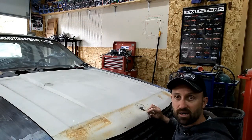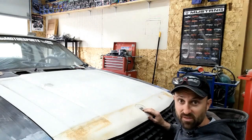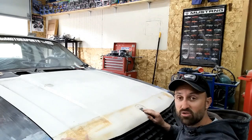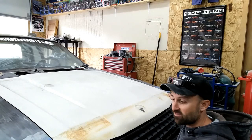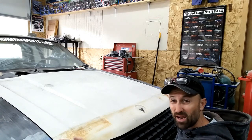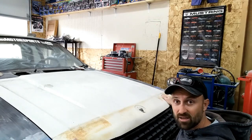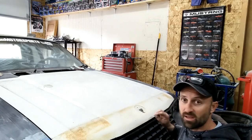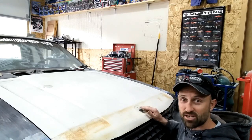you can then use your fingers or whatever you want across there. I like my fingers personally because it gives me the tactile feeling, but use your fingers left to right and feel. How does it fit against the fascia? Does it fit about the right way? You can always measure under here, left to right, but you can also feel it if you don't have anything to measure by. Last piece, once these fit, is to then adjust your hood latch.